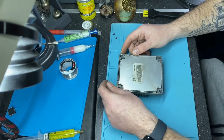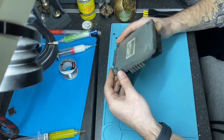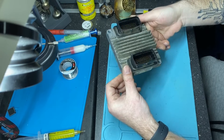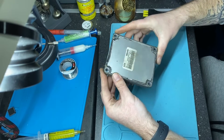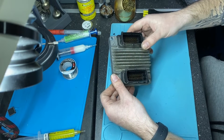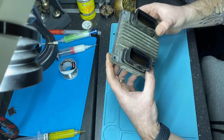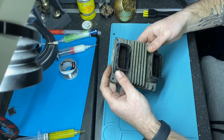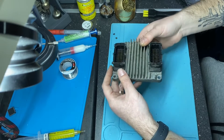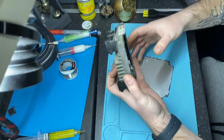I will also check the fuel pump, which from what I saw is failing. I will do the fixing. I think everyone knows the common issue with this type of problem — normally it has a ceramic PCB inside, connected with some jump wires between the ceramic PCB and the connector. Those jump wires are failing, and you need to remake the jump wires in order to get it working properly. So let's start working on the DCU.